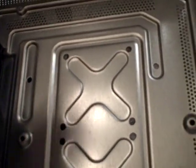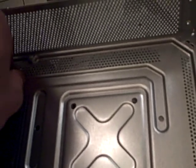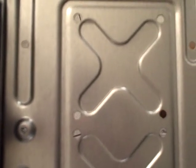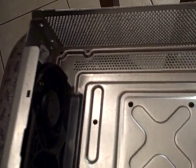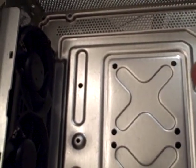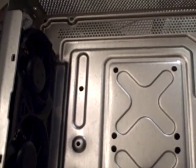Of course it will be going in from the back side, but the holes are perfect. I blew it out with the air compressor to make sure there were no metal shavings left after drilling. So now we're ready to mount the motherboard back in. We'll take one screw, start it in from the back side, put four washers on each screw, then set the motherboard in place. Then on the CPU, one washer, and on the GPU, two washers.